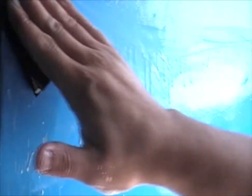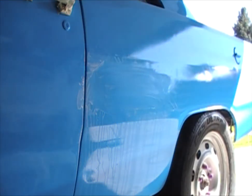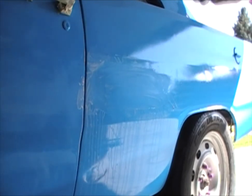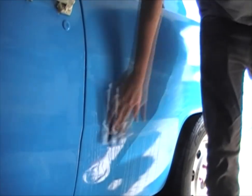As you can see, a little bit of elbow grease and you can get rid of the majority of it without actually ripping up your base coat. Then you're gonna take some prep all or alcohol after you've sanded it all down, get a lint-free paper towel, and wipe down to prep all the areas that you're gonna be painting.